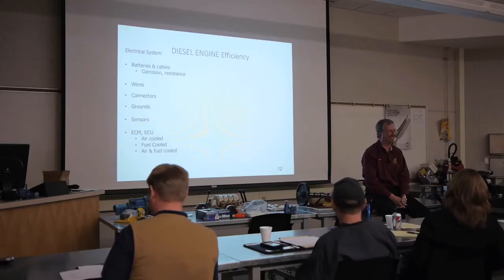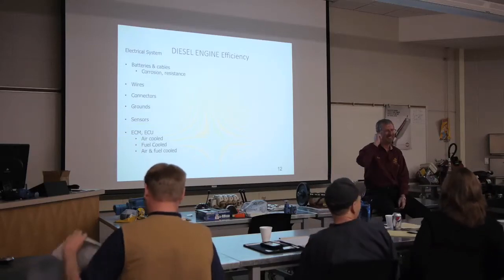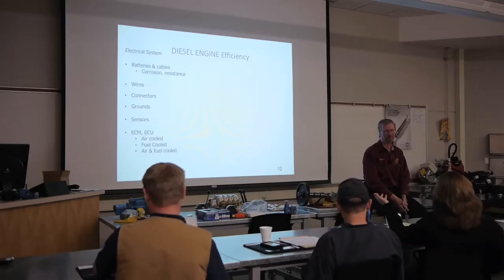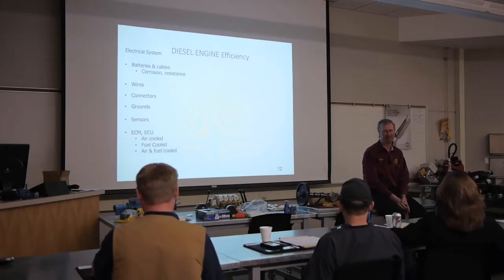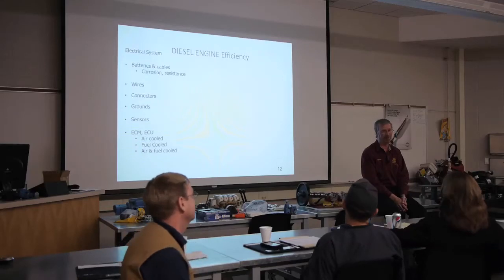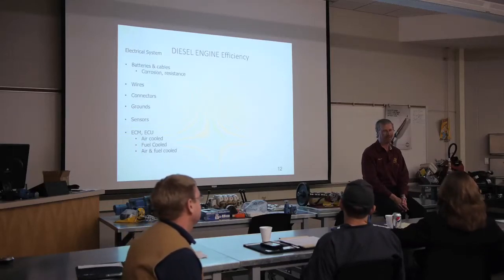Good Lord. So, if you have a dead battery and somebody jumps your vehicle, people say, oh, let it run for about a half hour. That's crap. That will put what we call a surface charge on it. Okay. And that's all it's going to do. It's not going to charge your battery. No. Everybody does it. Yes, they do.